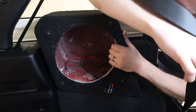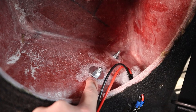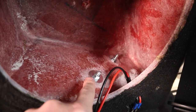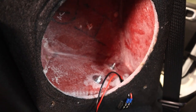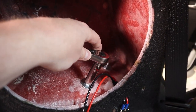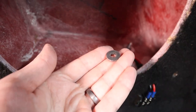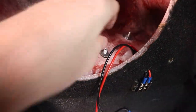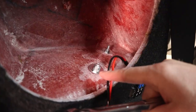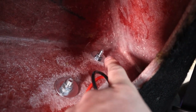Now we're going to place the enclosure onto the wheel well, allowing the square neck carriage bolts to pass through the holes in the bottom of the enclosure. This step is very important: we first take one oversized washer on each bolt and apply one five-sixteenths inch hex nut onto each bolt, tightening this down to fully seat the enclosure. With the enclosure fully seated, we loosen only one bolt at a time. With the other bolt still tightened and everything clear, we apply the rubber sealing washer, then the oversized flat washer, then the split lock washer, and finally the nut, and fully tighten this assembly. We then repeat the process for the remaining bolt.